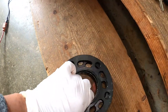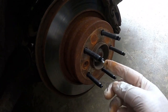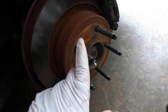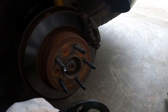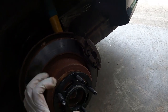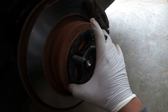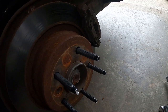Now for the back I want to put 10mm spacers. While I was distracted by Krippen I went ahead and broke my little screw that I used to tighten — I don't have my torque wrench at home today. I was doing it by hand and over-torqued it. This is what happens when you don't torque to spec. Now I'm placing the 10mm spacers. This one is hub-centric, meaning it has a little hub so the wheel will sit on top of the hub and the lugs. I'll put anti-seize grease here before mounting the wheel.